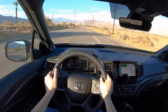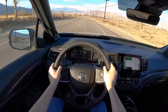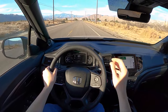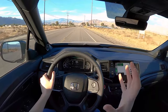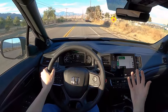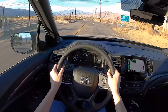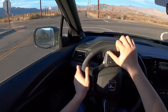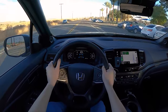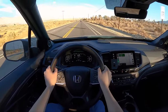Something worth mentioning about the Trail Sport trim is that it comes standard with all-wheel drive. You can see the display here of our iVTM4 all-wheel drive torque vectoring system. With four drive modes — normal, snow, mud, and sand — it can change how much power gets sent to each of the four wheels. It can send up to 70% of the power to the rear wheels, and of that 70%, up to 100% to either side. Off-road you can really tell this thing is constantly thinking and adapting, feeling out where there's grip and where there isn't. I love how you can hear that switchover when it hits VTEC. Love a good Honda.